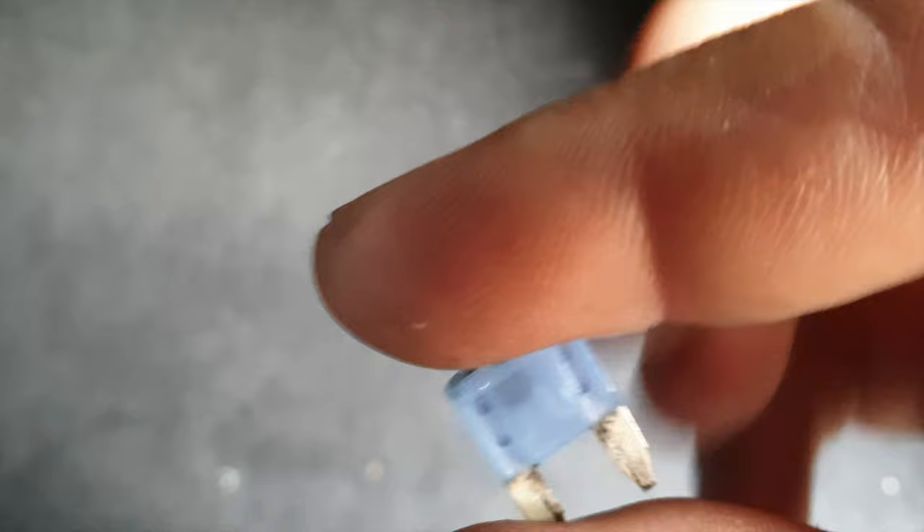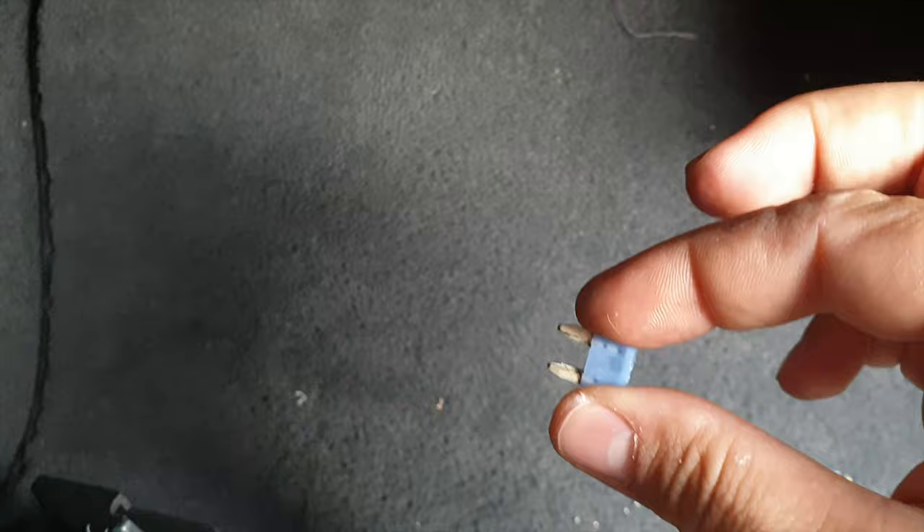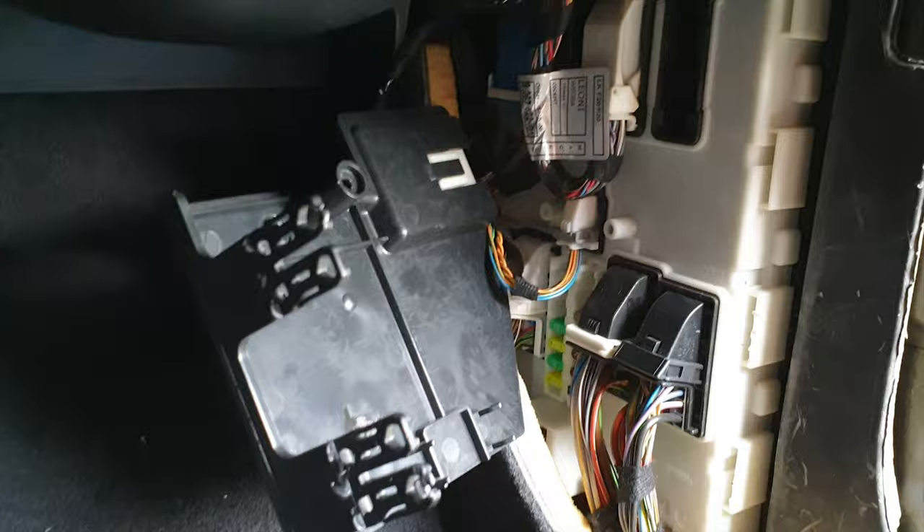As you can see, it's damaged — the metal in the center is gone. Just check this, and after you replace it your horn will be functional again. This is one of the panels, because you have three zones: one on the engine, one here under the glove box, and one in the back of the car. To access them it's a bit difficult — you have to remove these plastics.